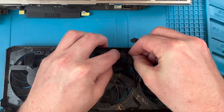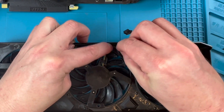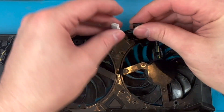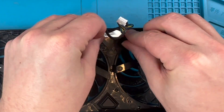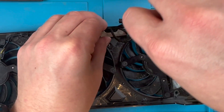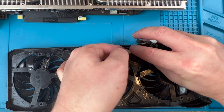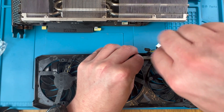And while we're doing this I'm going to give you those tips. Tip 1: Use the model number from your unit to search for replacement options — I will post it down in the comments below so you can find it easily. Tip 2: When buying don't solely rely on the model number, also check all the dimensions. If the seller hasn't posted the diameter, the screw hole dimensions and the depth for the unit, check with them before buying. I will post the dimensions from the fans I removed below also to help. Tip 3: Aftermarket fans may not always be correct — they may be QA fails or even counterfeit units, so pay attention to the pictures and quality and compare. If you don't get what you expect, check that you are able to return for a full refund without excessive return postal fees. eBay provides buyer protection if you buy there.